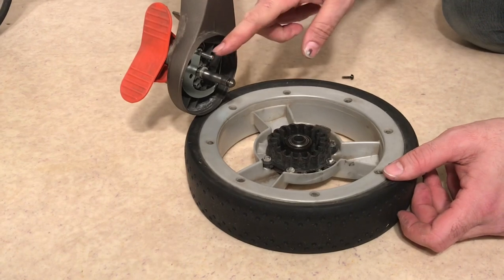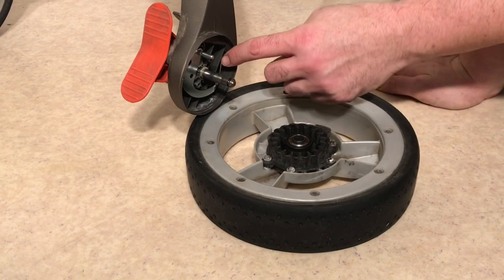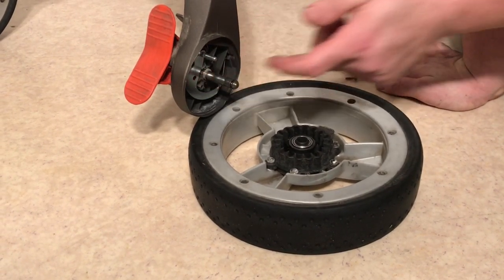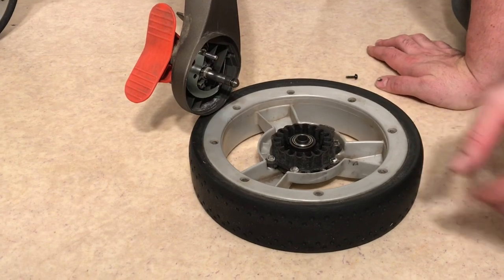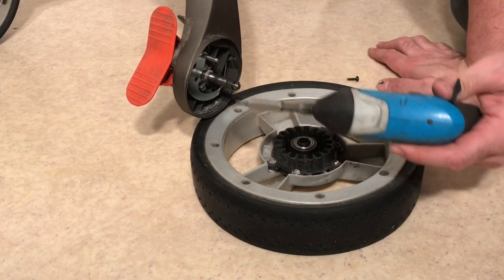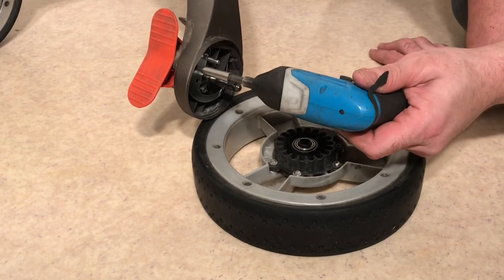This piece is moving the pin up and down, and on the tip there's a wire that runs all the way through the back of the frame and activates a similar piece on the opposing side. So if you're having trouble activating the brakes on the side where the pedal is, there's a good chance that the screw is loose or the pin is loose.